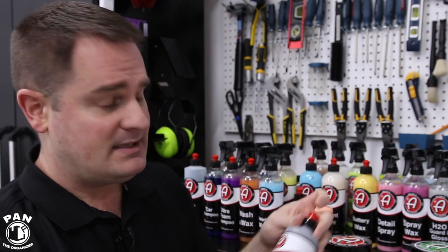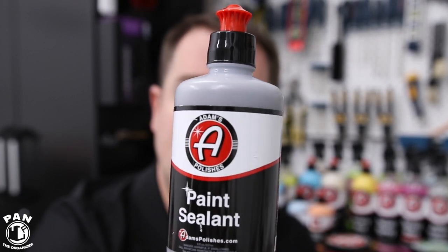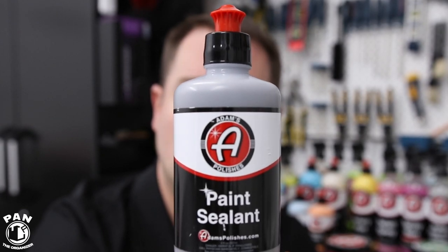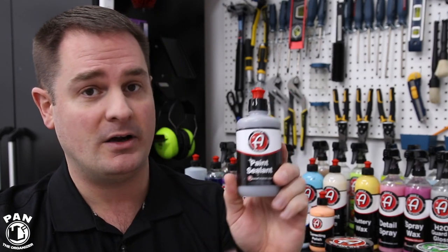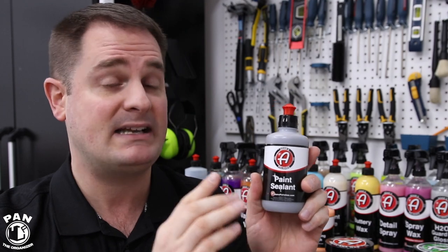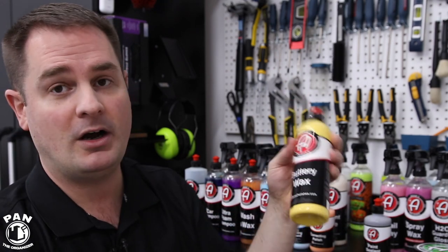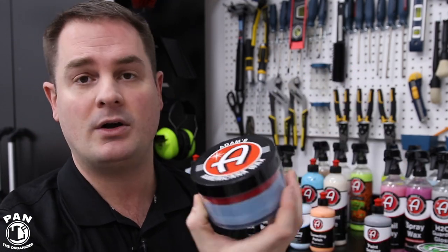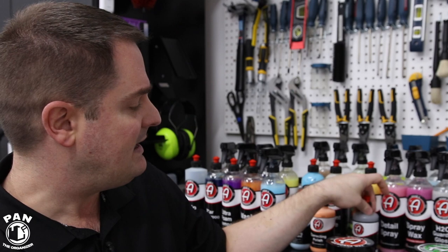After that you have the synthetic form — the paint sealant. This has double the durability of a traditional carnauba wax and comes in liquid form, very easy to apply the same way as a liquid wax. What some people do is apply a base layer of paint sealant — it has a colder shine but higher durability — and then top it off with a favorite layer of carnauba wax, either the Buttery Liquid Wax or the Americana Wax. That top layer gives a warmer glow with better depth and gloss, so you get the best of both worlds: durability of the sealant and the warm shine of carnauba wax.